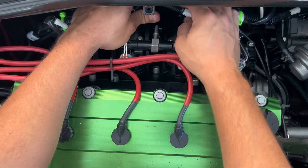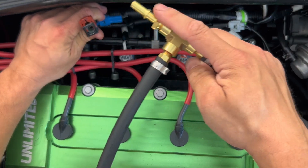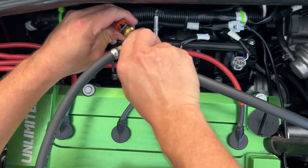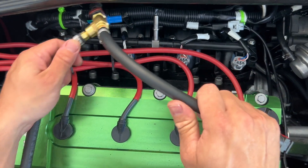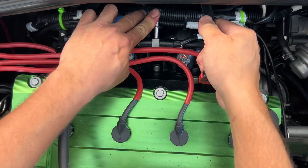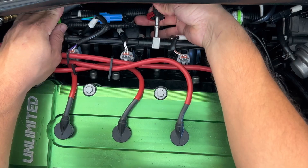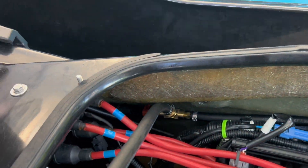You'll see that there's some fuel that will dribble out. We're now going to take our tester — you can see it has a brass quick connect fitting already. So we're going to insert that, make sure it's fully seated, and then push that plastic clip down. And then this lead here, we're just going to reattach to our fuel rail connector. Slide it on just like that, and you can see it goes in line just like that.